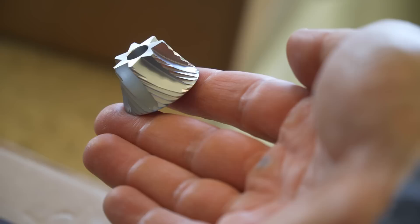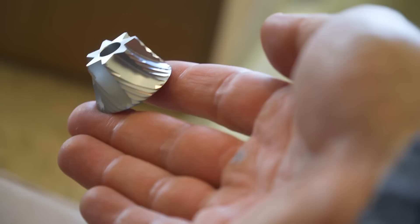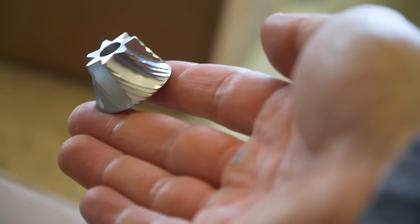Let's take it apart and see if I can do that without breaking it. I don't think the camera's doing it much justice — I wish I had my old 15mm f/1.4 to get real close. But the machining and finishing is really, really nice. This is the outer part of the conical set, you can see how the burr carrier is bolted in there. To throw it back together: burr set, make sure you have a spring on it, put it onto the little shaft, get your micro-adjuster, twist it until it catches. The fit and finish is really nice.